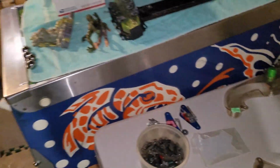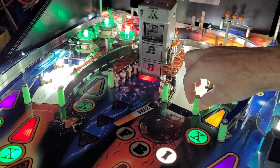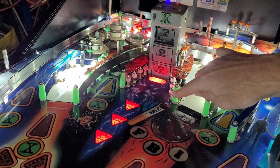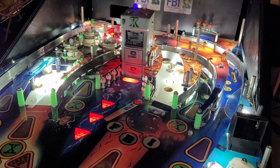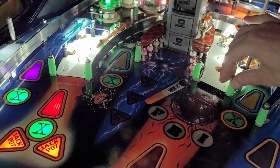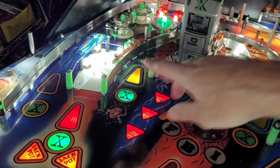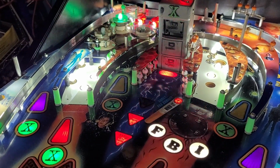Also, a couple people mentioned that these tapered posts really should be thick portion at the top. I have it thin portion at the top. And it makes sense because that would potentially prevent air balls. I kind of thought of that as I was installing them. But now that I've got a couple comments to verify which orientation these are really supposed to be in, I'm going to spend a little bit of time and reverse all these guys so that they are thick portion up, thin portion down, and then potentially prevent any air balls. So I'm going to do that.